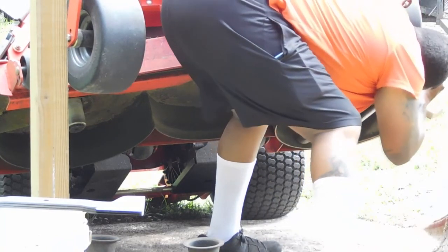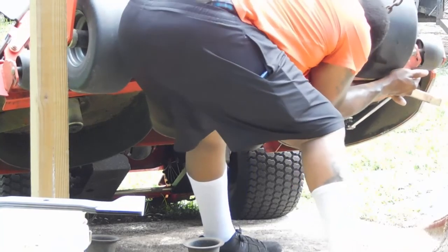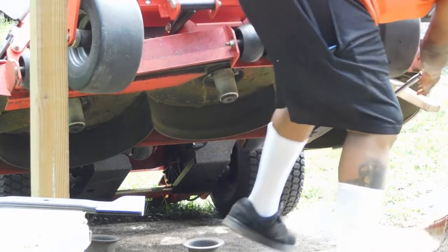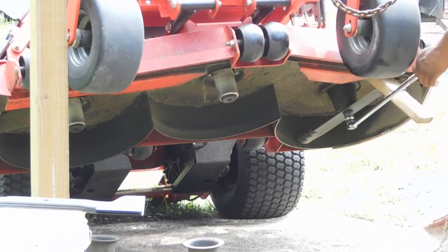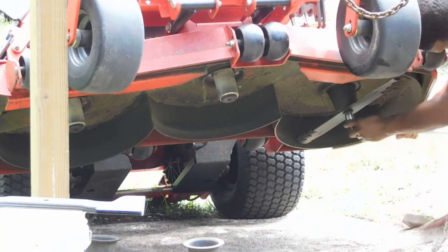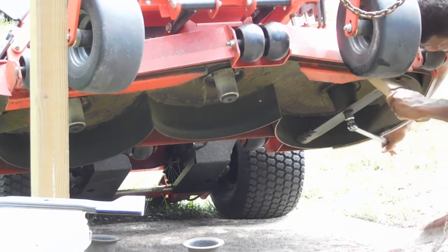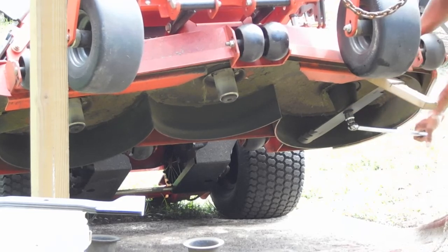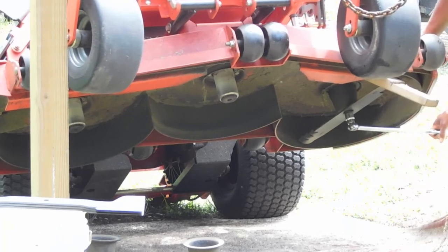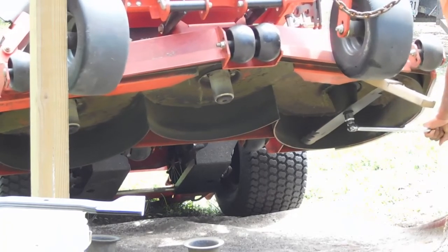It only sounds natural and normal. But make sure you put the board on something solid. Look at how much tension I'm using. Put the board on something that's stopping the blade, and then wedge it between the blade and the side of the mower. All mowers are a little different, but you will find somewhere to wedge that board in. Make sure your wrench is straight and not wobbly so you don't strip it. And then put some love behind it.